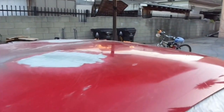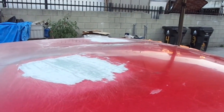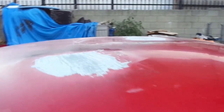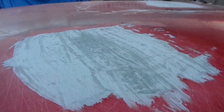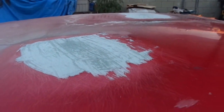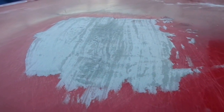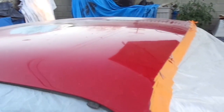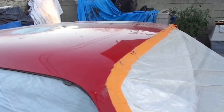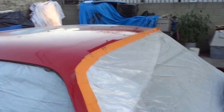If a spot is damaged and has a hole, then I have to weld it and patch it with a small plate. But if it's not and it's decent, I just put the mixture, go one layer, then sand it down again, and go for a second layer — as you see it right here on the top. This way it will not rust after the refinishing and priming.